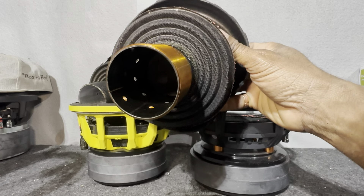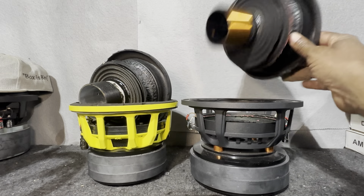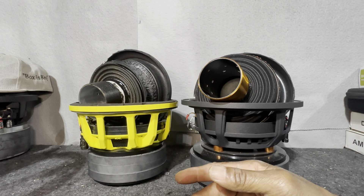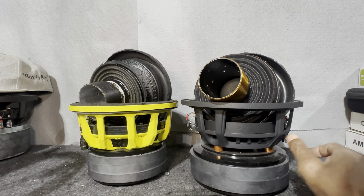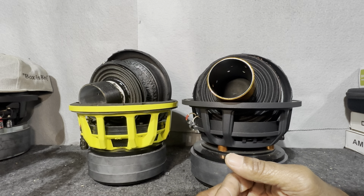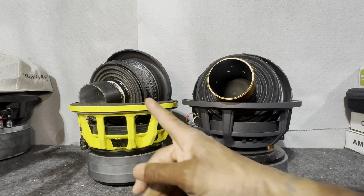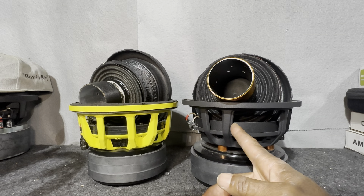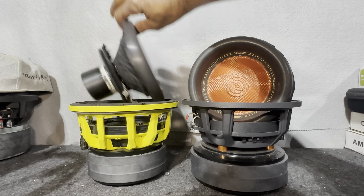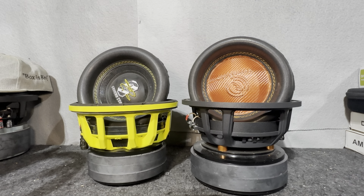So you can get substantially more output out of this driver than you will from this one. Someone said they rate this driver as geared for sound quality — well, looking at the manual and how they market it, both of these companies pride themselves on sound quality and the accurate reproduction of music. But this is just a new guy on the block. This has a seven and three-eighths inch cutout, this has a seven and a half inch cutout, so the total SD is larger, and you can see that here — it's a lot larger than what they have on the Ground Zero.